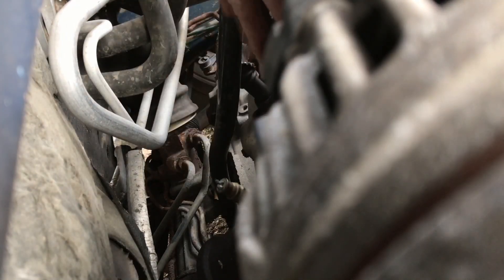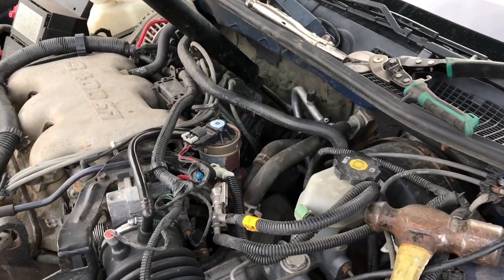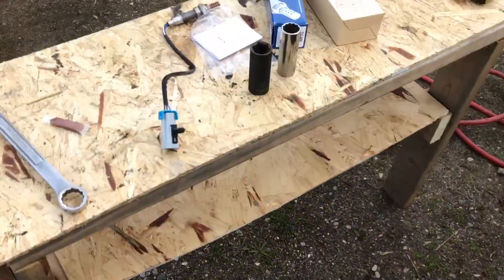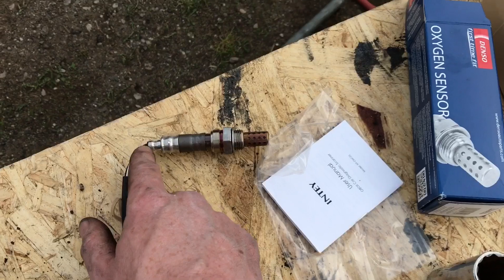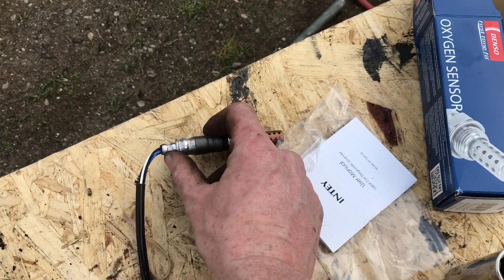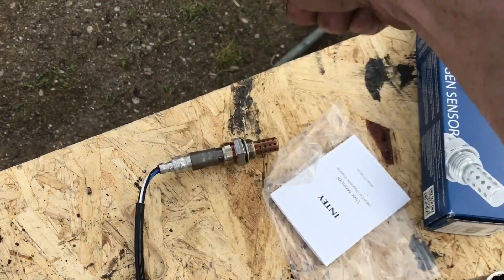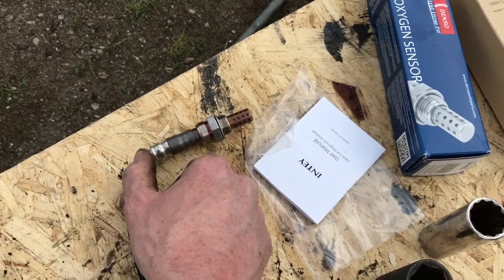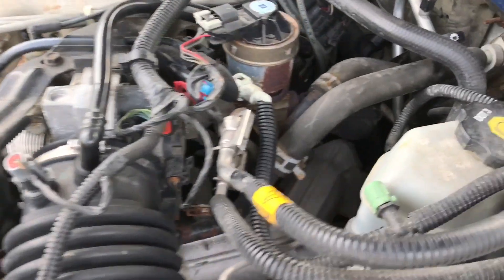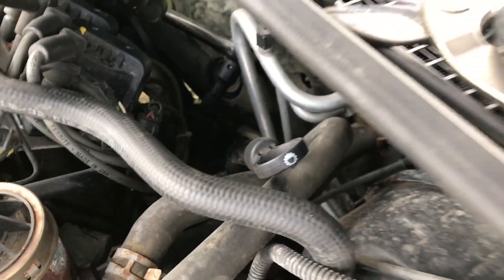Right behind it there's gonna be a little sensor plug. I'm cutting it off because I want to see if I can throw a socket over that and get a little more leverage. What I did is on the old one I went ahead and cut the back of the wiring harness, then took a hammer and beat that end off. It's pretty easy to bang out — just take a hammer, go behind the engine bay and beat it off, then pull that part out so you can slide a deep socket from the top down just like that. I got the deep socket down on it.